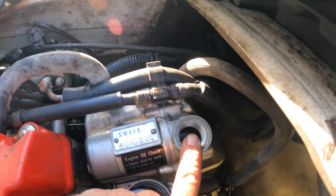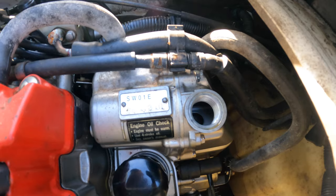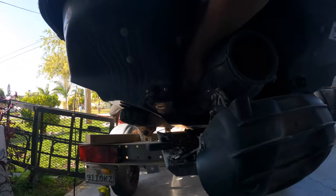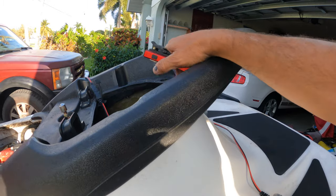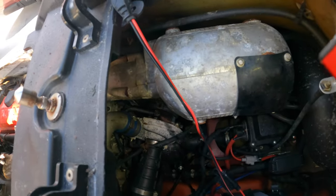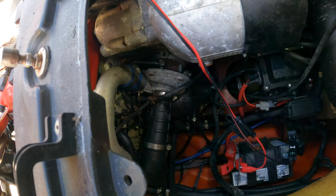I rigged a nice little suction cup that goes down into the hose, removed the oil filler cap up here, and sucked out the oil. We also changed the oil filter. Now we're waiting on spare parts for the bushing that goes through the back. Changing the oil filter on this Honda is a little more critical than you'd think. You take as much oil out as you can from the front with the oil filler cap, but when you take the oil filter off it gives you about a quarter quart more. Then you have to go down to the back as well — underneath the turbo is where you'll find the other oil access.